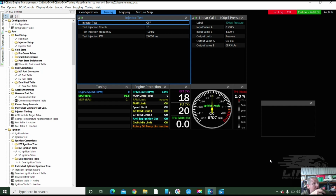And that's quite normal. If I set up an ECU from scratch, from nothing, I'm okay with it taking 2 or 3 or 4 hours to go through and check everything. We haven't run this yet, so we're going to run it. And there'll be some more checking that all the sensors are reading like they should. If the oil pressure is reading like it should. If it had a fuel pressure, we'd check that. Temperatures are good. All that stuff is good.